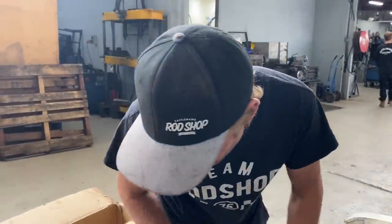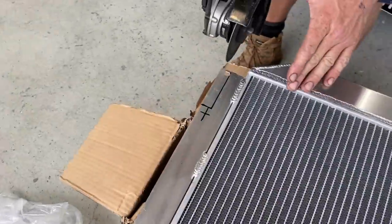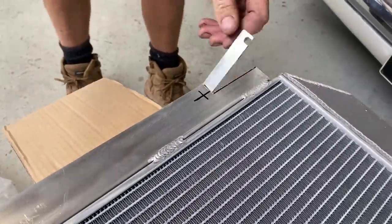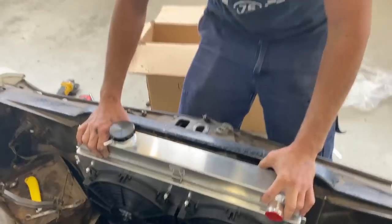There's a small slide issue — sliding it down behind the radiator box, it just touches the top of the rail. So I'm going to measure the width of the rails, measure the bottom of the radiator brackets, and slice off what we need to drop it in again. It's still just hitting down the bottom, so we'll cut a bit more off, then try putting our upper bolts in, sit the bonnet on, make sure it closes, then finish drilling holes and mounting it and fitting the hoses.